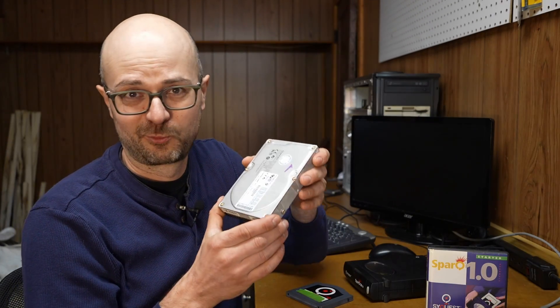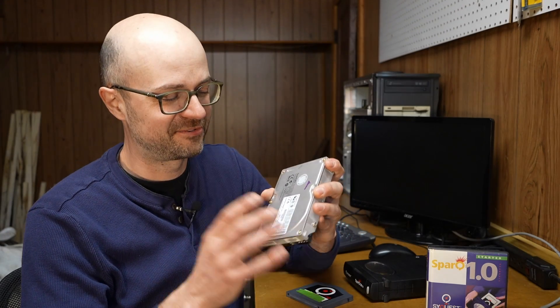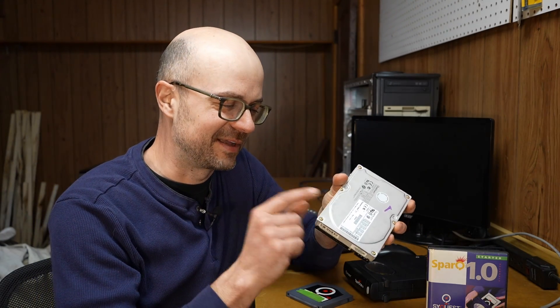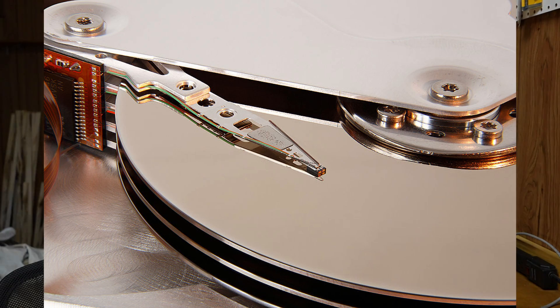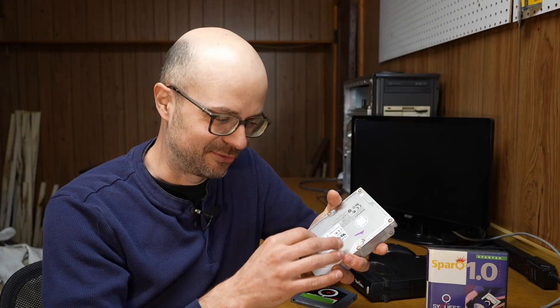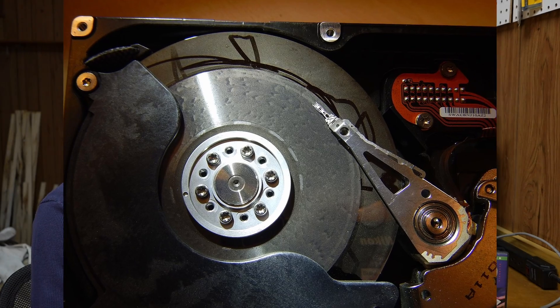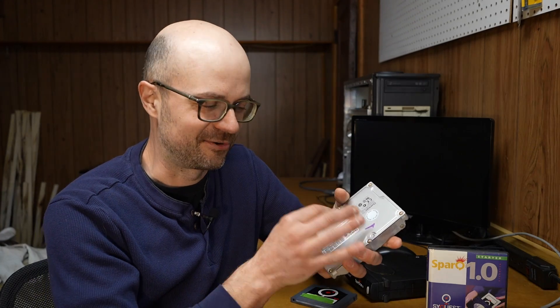Here's where we come to the problem with these types of discs. There is a reason why a hard drive is very, very tightly sealed — it's because if a single grain of dust gets in there and gets in between the platters and the read head, it could cause a head crash, which is a catastrophic failure where the head digs into the platter, rips into the actual magnetic storage medium. That's permanent damage to your data and permanent damage to your drive, because the heads are no longer aligned properly.